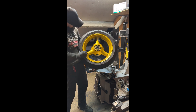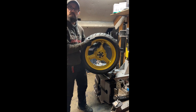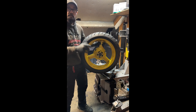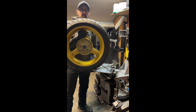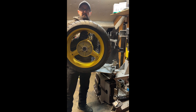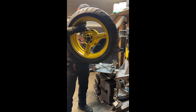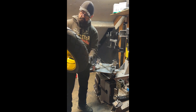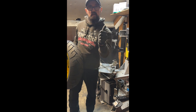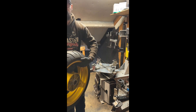It does aid balancing. It's not absolutely necessary because you can still balance them up, but if you line the dot up on the tyre with the valve, it does make that job a little bit easier. Not much cleaning, but I'll give the rim a polish before they're handed over — get that extra tyre rub off. Right, thanks for watching. Like and subscribe and do all that other shizzle that you're supposed to do.